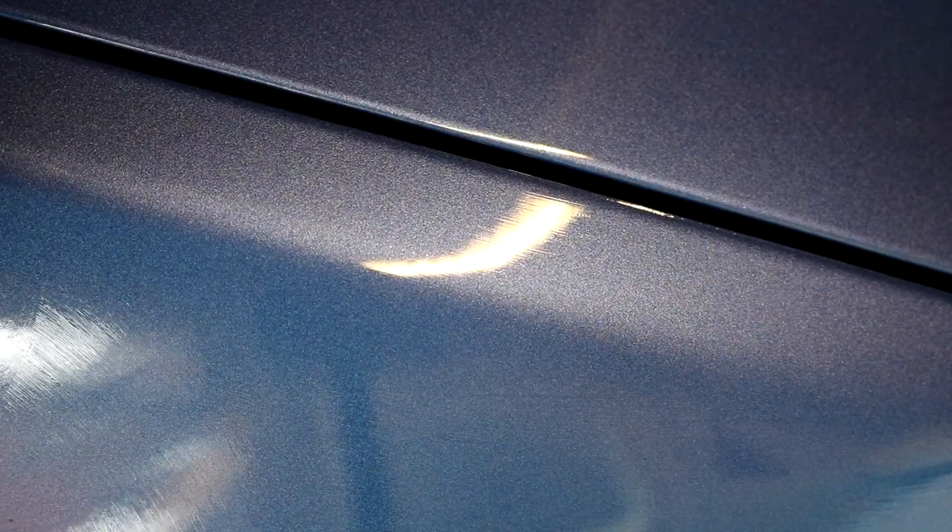When you apply this product, the first thing you notice is it feels and looks just like a full blown ceramic. It leaves that kind of oily layer where you can see the lines where you wiped it on. They say buff it off immediately, but I'm in my garage and the panels are cool. I eyeballed it for probably 30 seconds to a minute, just looking for signs of the oils and the solvents starting to lift, and then buffed it as it's on the turn. Hopefully when you do that you get slightly better leveling and the product actually sticking down onto the clear coat better.